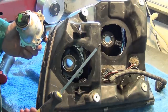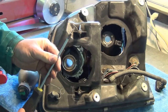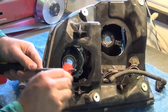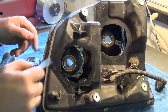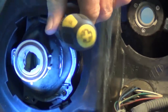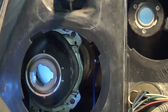And you'll need a Phillips number 2 screwdriver for that. Number 2 is exactly the right size to fit in the screw that's inside there. That's what's inside. As well, I find it's a little handy sometimes to give your screwdriver a magnetization at this point, just so that the screw, if it lets loose, it doesn't fall down inside there. Now let me zoom in a little bit and I'll try to show you. There's one, there's another. But you kind of get the idea. You need to get those four screws out of the outside positions.